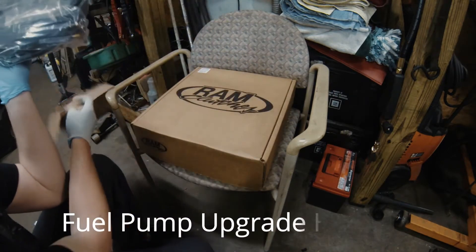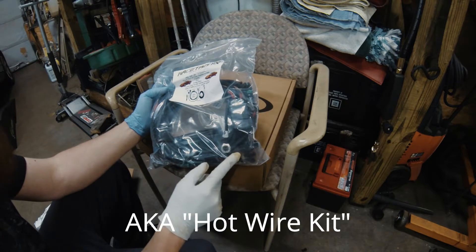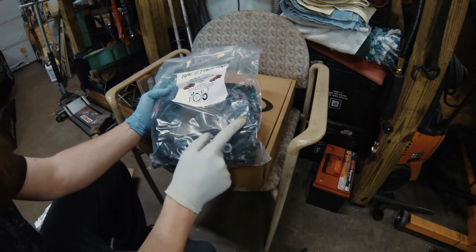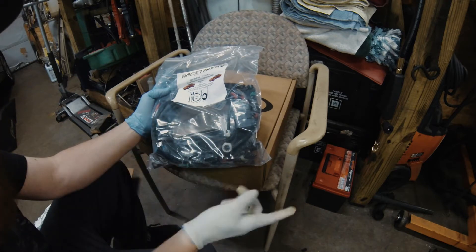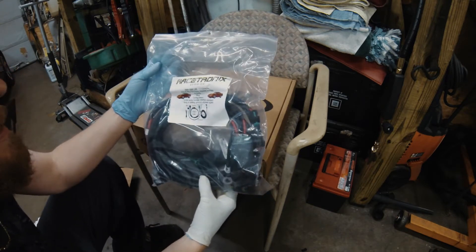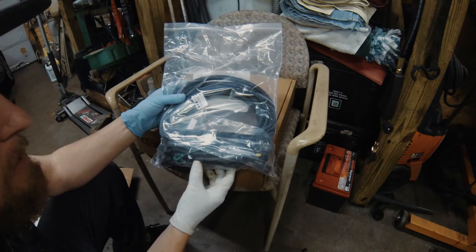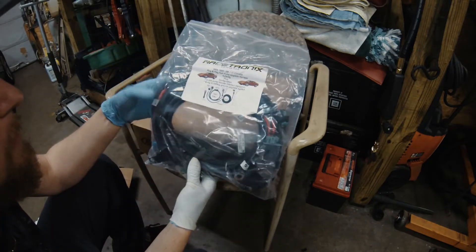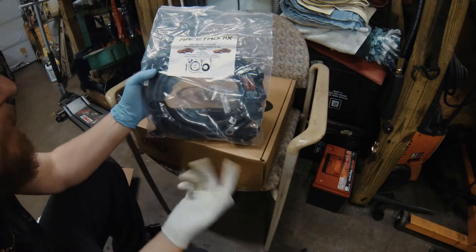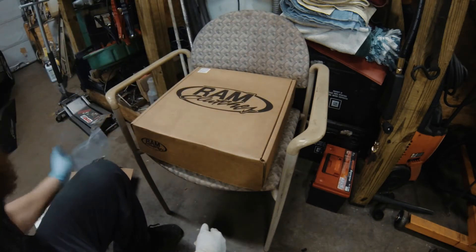Right here we've got a Racetronics kit. You could go ahead and make these kits yourself, but it's nice to have them all done up with weatherpack connectors. This basically plugs into the factory fuel pump wiring and you run an additional power and ground wire to activate a relay to get voltage straight off the alternator, so we'll be able to run 14 volts to it. I'm not really a fan of those boost pump things — they're kind of like a band-aid in my opinion. Racetronics makes some really nice stuff; you may also be able to get something like this from Caspers. None of these guys are sponsors — it's not a paid video — but I do use this stuff on my own car. It's pretty solid, already wrapped in weatherpacks. I've installed these on probably a dozen cars over the past five years.